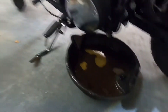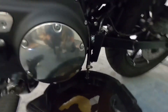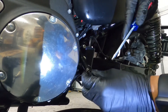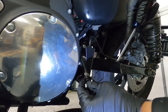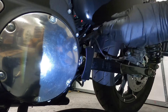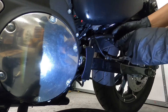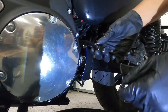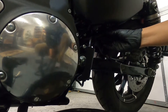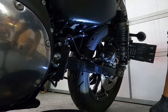Time to finish this up — got this plug back in place, going to fit it and tighten it down. Definitely not going to over-tighten this, but put enough pressure that you can see it squeeze the hose, then pull on it a little bit. I don't feel any play — this is just past tight, so that seems good enough. This hose is going to be rerouted upward onto the clip held here. On some older models this hose hung down pretty low, but on these 2017s there's a clip, so I'm clipping it in place. Moving on to the oil filter.